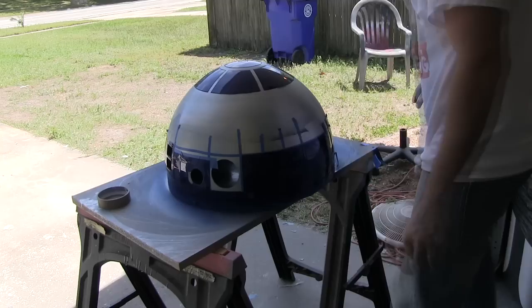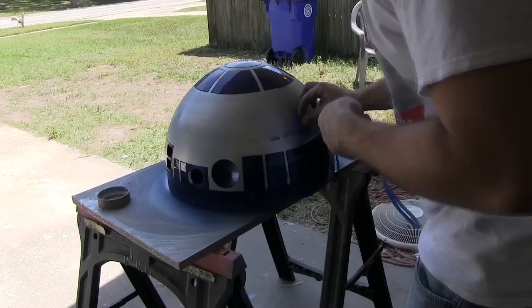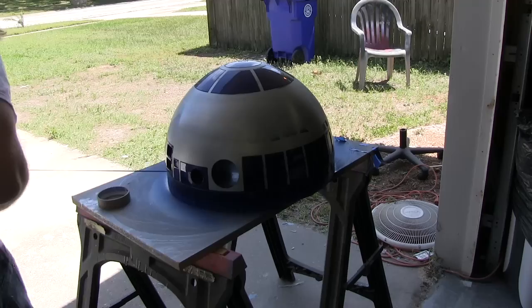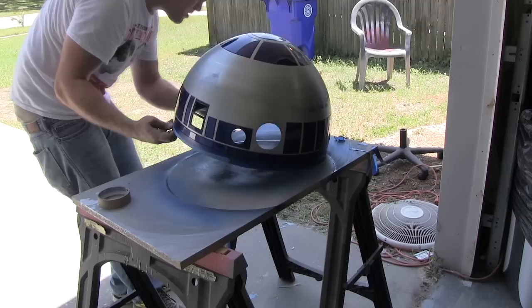I stopped the camera and mixed up clear coat. Waited about 45 minutes for the blue to completely gas off, and then sprayed the clear coat. If you don't wait for your first layer of paint to gas off and you spray clear over it — especially with automotive paints — that gas needs to escape somehow and you're going to get pinholes in the clear coat. Even in my two-day deadline, I still had time to wait for that to gas off. So don't be impatient. If you're doing rattle can paints, give it plenty of time — more than 45 minutes to gas off.